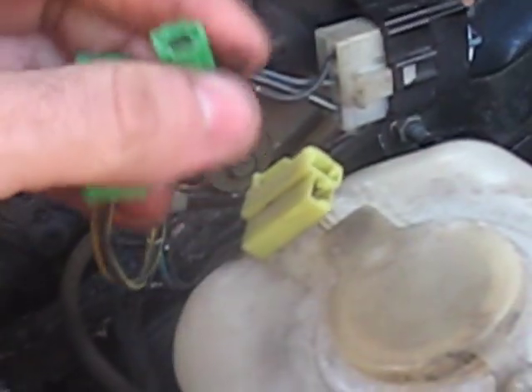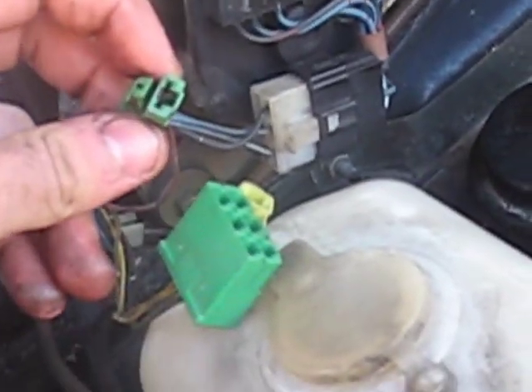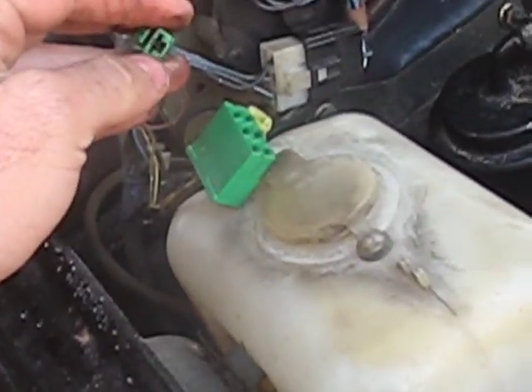To time it, I'm going to have to ground out — see these three connectors here? — to ground out the little one. Just send a wire from here to any known ground, for example right there. And then I should be able to time it. There's like a timing advance, and by grounding it out, it shuts this timing advance off on the computer so you can time it properly. So I'm going to do all that, throw this thing back in, and we should be good.